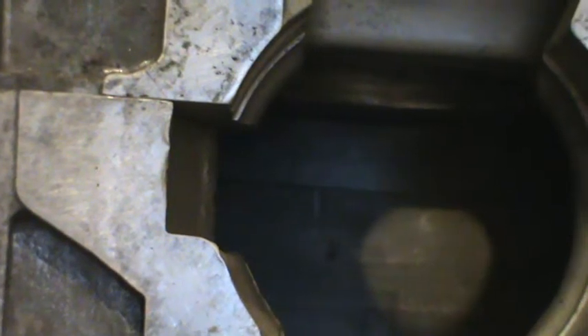Can you see that? That is where the crank casing - the engine casing - is warped. It's, believe it or not, actually warped by 0.15mm. It doesn't show itself normally. But if I do it again, you'll see that it goes in the back there - there is a drag. This is a 0.1mm feeler gauge, and it goes through quite easily.